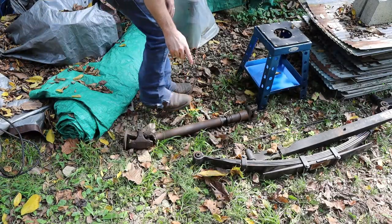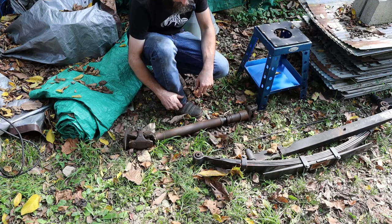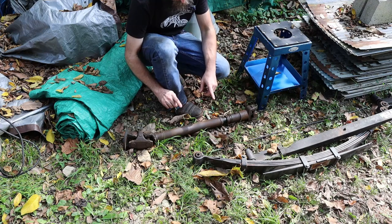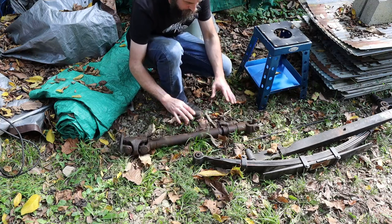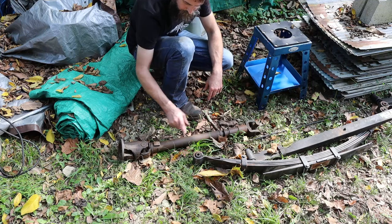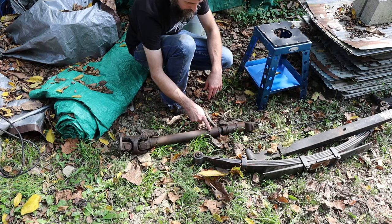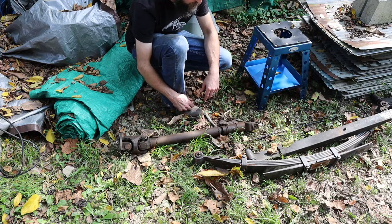Scott was also nice enough to bring me down a front drive shaft. Now this is out of an automatic truck? An automatic truck, Turbo 400, New Process 208 transfer case, which is longer than the SM465 205 combo. Yep, but the problem that I have with the one in my truck right now is that the spline here, where they slide back and forth, is completely worn out. So mine, I got a half inch of movement side to side. This drive shaft is going to be longer, but it's got a bad ball joint in the knuckle here that'll have to be replaced, and I'll cut this thing down to the proper length, and it should bolt right up after that. That's what I hope anyway. Correct.